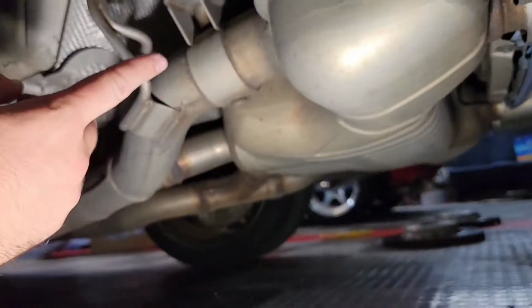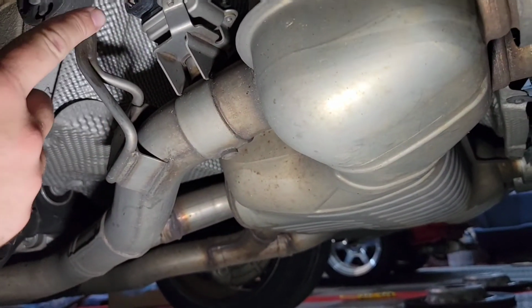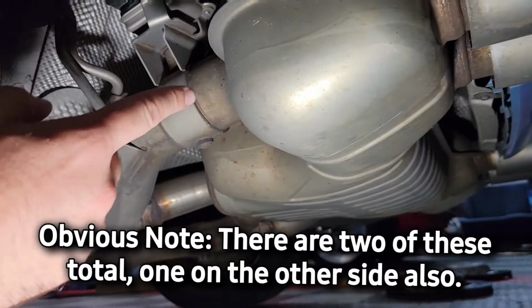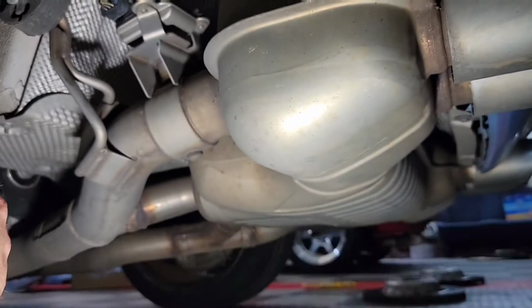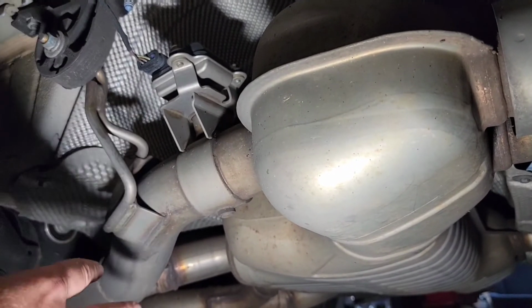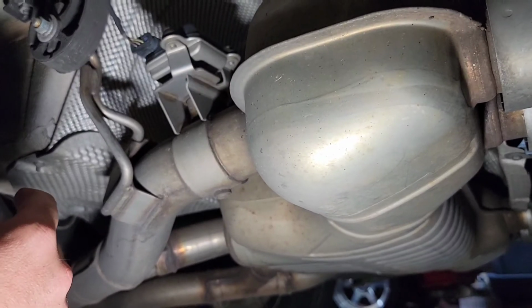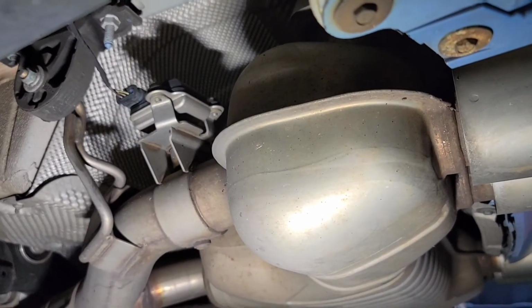And what you can basically do, and that's what I'm getting ready to knock out, is I'm going to flip the car on, put it in sport mode, unplug that so that the baffles stay open, and then I'll just, you know, tape off all the wires and stuff like that. So the exhaust valves will be open all the time, and the obviously stock exhaust is not very loud at all, but at least I'll get a little bit more of that straight six turbo noise out the exhaust. So I'm going to do that, and then I'll put it all back together.